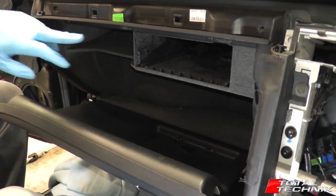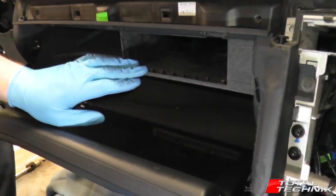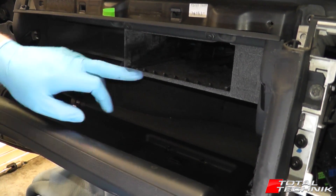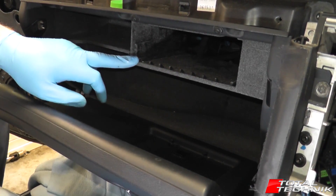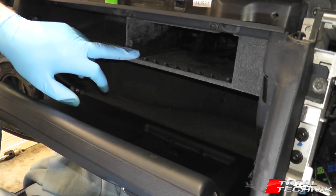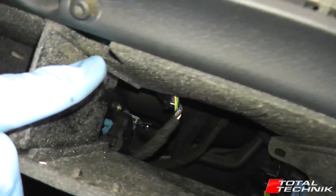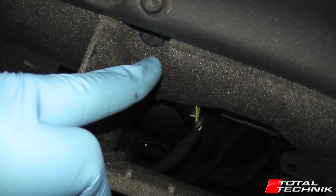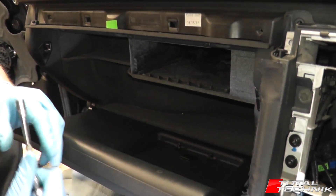As I mentioned before, I left the center bolt in purposefully. If you don't have the CD changer option, it will just be these five bolts holding it in — that applies to probably 75% of viewers. However, if you do have the CD changer, there's an additional bolt just there — you can see it on the end of my finger. We'll get that one removed, then remove this final center one, and the whole thing will be ready to drop down.